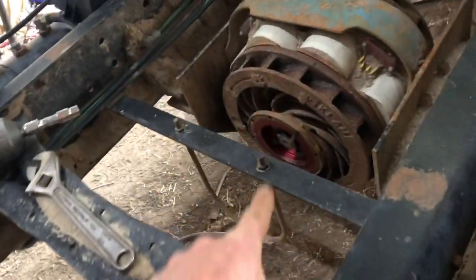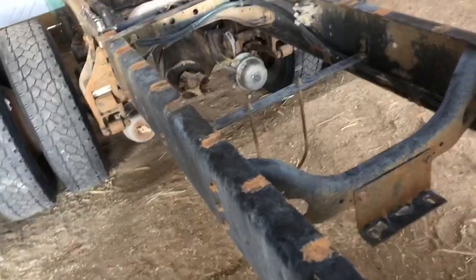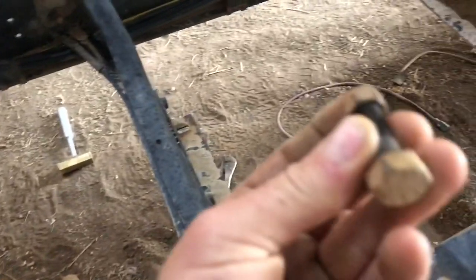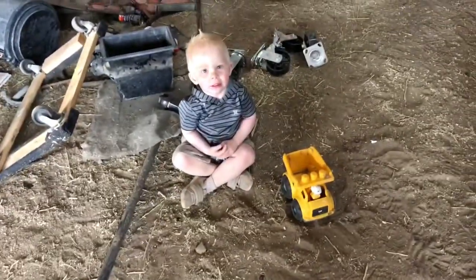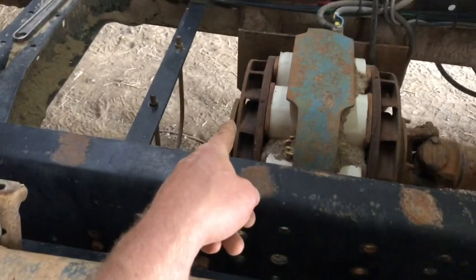Shaft's removed. This is the centerpiece that won't be used — this piece had a flange on it with eight bolts around it. Eight little tiny bolts — that's all that's connected to move this entire truck with its load. This was the flange mounted to the back of the brake driveline retarder, and this was the slip yoke at the front.